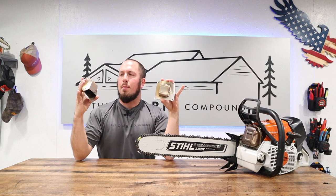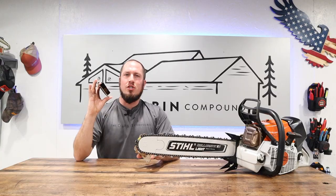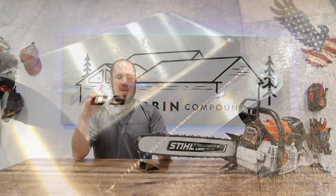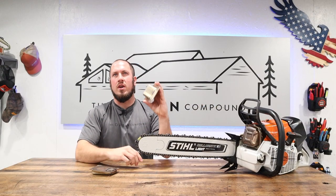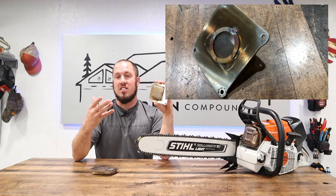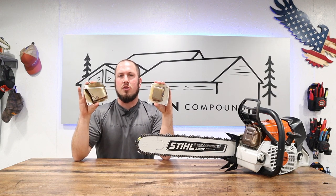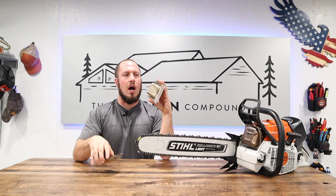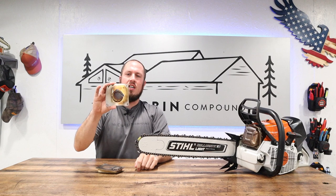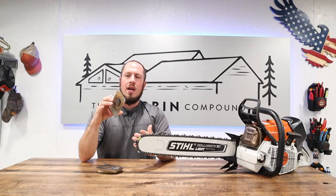Two different theories at play here. The BarkBox has 0.825 square inches of exhaust port measured here on the end. And Jason's has something like 1.7 square inches of exhaust port. So I think it's 1.77. So nearly double or over double of the exhaust port as the West Coast BarkBox. The Egan muffler is called the straight shot because it does have the port straight out of the exhaust port. Two different theories here at play.